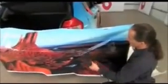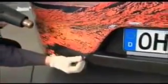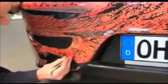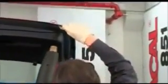The approach to vinyl application to the rear spoiler is the same as for the front spoiler. Preheating of the vinyl in broad brushes and its even smoothing out from the middle outwards with a squeegee are again the most important operations. Edges always need to be well heated and pressed on firmly. Now, the remaining vinyl is gradually applied, with the hot air gun and squeegee used alternately. Once again, please ensure that all cut edges and vinyl ends have been folded to the inside.